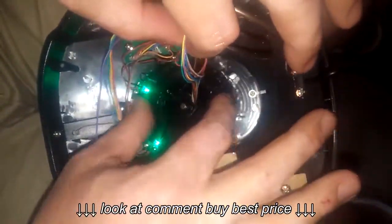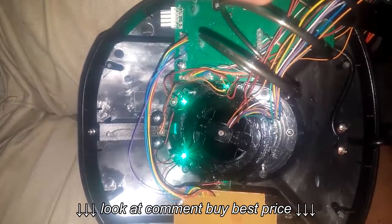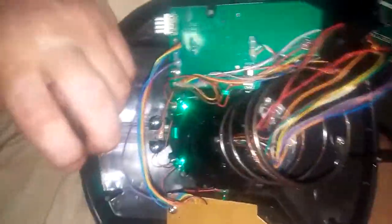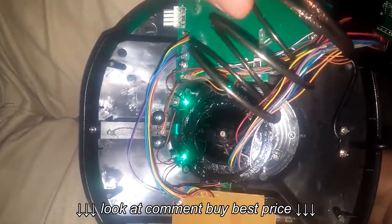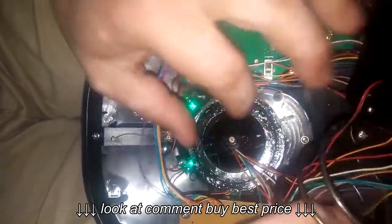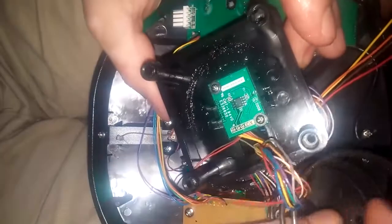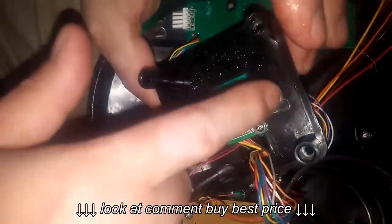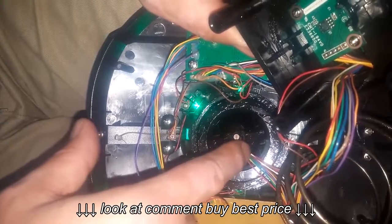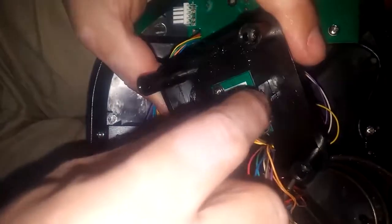When you put this back you must make sure your trigger is facing the right way — the trigger must be facing forward. You'll see these two little things on the inside; they will line up with those slots. The easiest way to remember is: the square where the wires come through must be on the same side as where the wires exit the joystick when the trigger is facing forward. I also put grease on these two pieces where the joystick presses against those two little U-shaped slots.